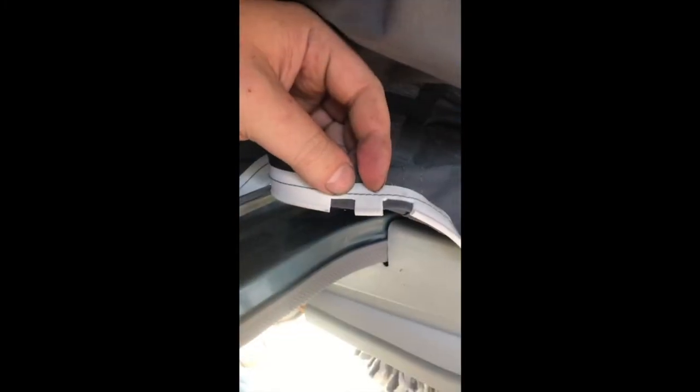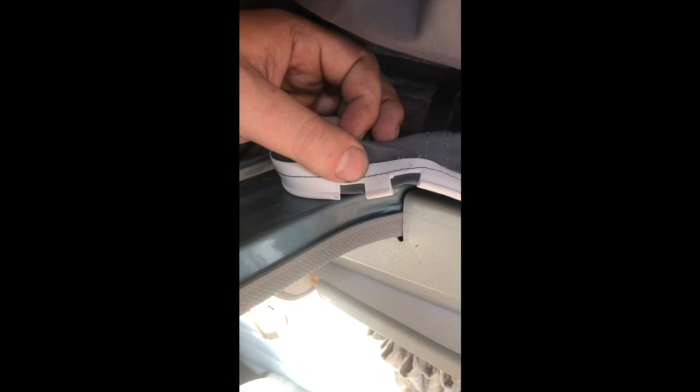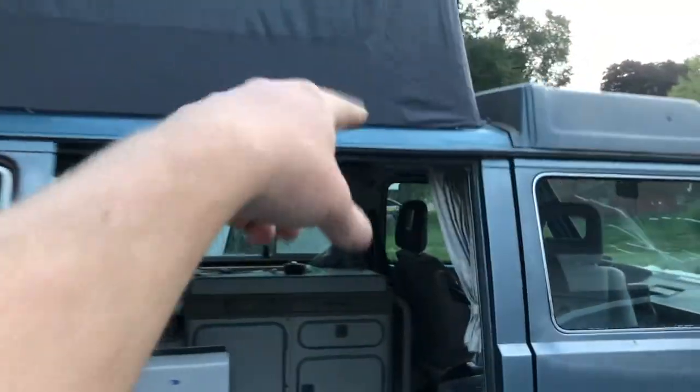I really love this seal. The back corners have a gap but there's always been a gap there on every one I've ever seen. A pretty key thing they leave out in the Go Westy video: to make it around the front and back corners, you want to cut these little grooves — this is the way the factory did it. It makes a much tighter seal, fits a lot better, and clears the corner way better. Make sure you cut those out. The OEM style German canvas looks really nice and it's all the way on and looking pretty solid.